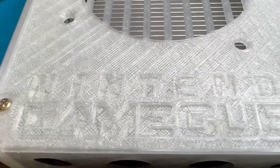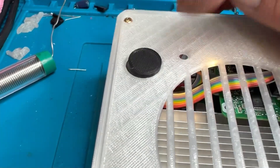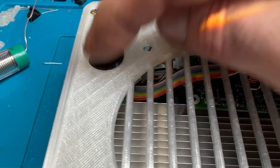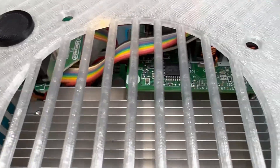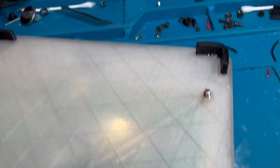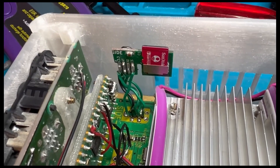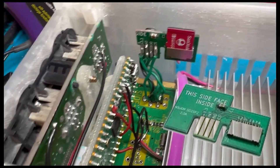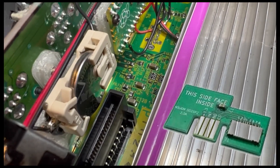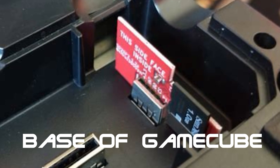So this is the HD version. What have I done differently? There's the reset button — I'm thinking of filling the GameCube logo in with resin so it stands out more. I'm also going to superglue the button onto the main switch to stop it sticking. The main difference was that the power board is separate on this model, which had to be wired separately, detached from the original GameCube and then soldered directly onto the daughterboard. There are a couple of feet because the screws stick out, and I decided to mount the SD to SP2 converter there and hard wire it internally.